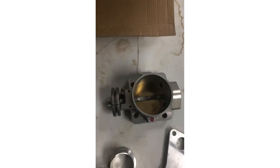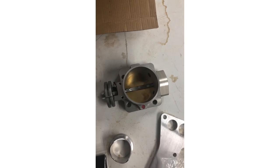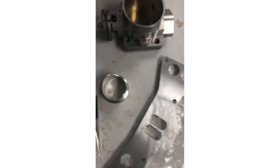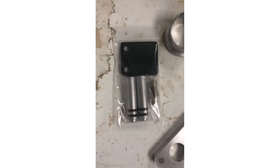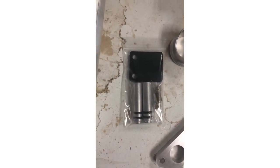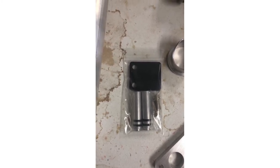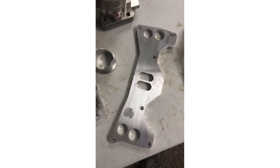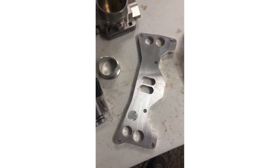I got this Skunk2 Pro throttle body in 70 millimeter, which is just a hair over two and a half inches — the size coming out of the intercooler. This is the ring that mounts my pop-off valve. This kit here eliminates the injectors on the center iron of my Mazda 13B, as I'll be putting an injector in each of the intake runners instead, so I'll cap those off. This is the main part I waited for, that really held me up and that I couldn't do anything without: my intake manifold plate. I needed it to start and design everything.